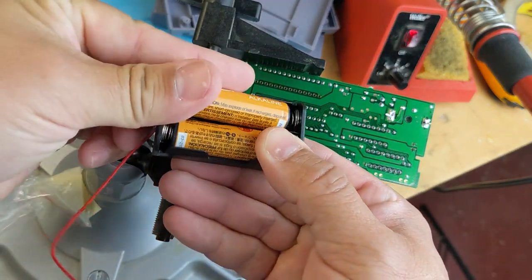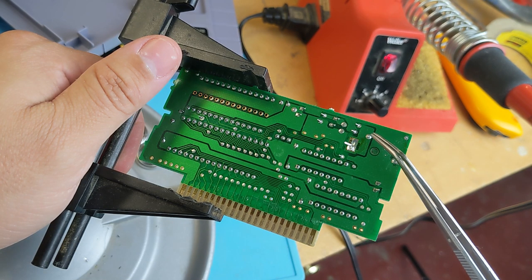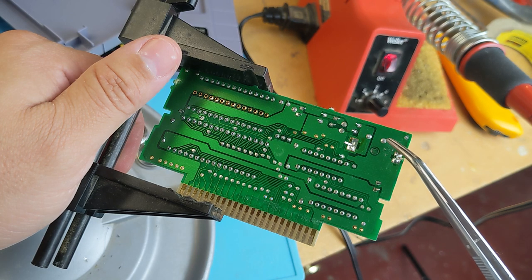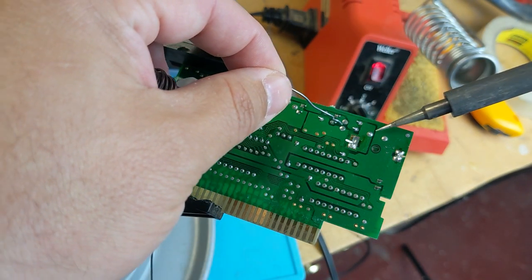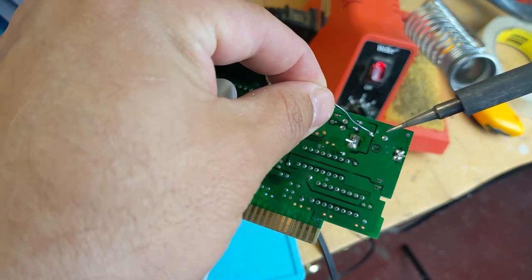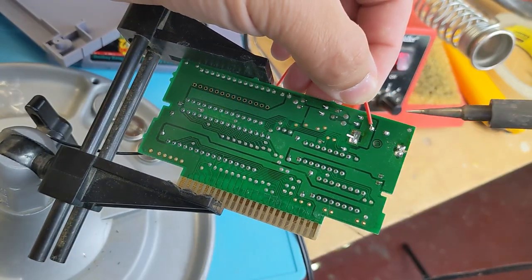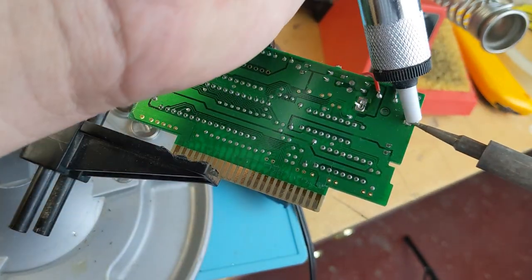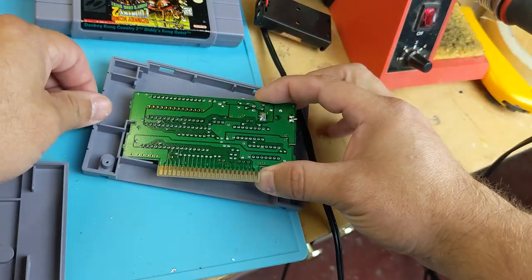The first method involves an extra component: a 3-volt double-A battery pack. This acts sort of like a pacemaker. The positive terminal shares the same trace with one test point, and the negative terminal also has a point on its trace — these are test points used in manufacturing. Just add solder to them and attach the pacemaker, keeping battery polarity in mind. Once the battery pack is added, you can remove the old battery and add the new one exactly as previously shown, then remove the pacemaker before buttoning it all back up.